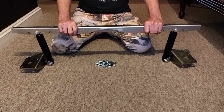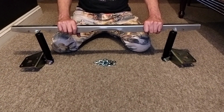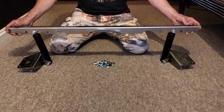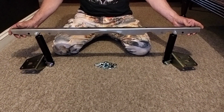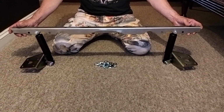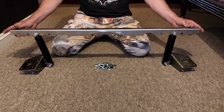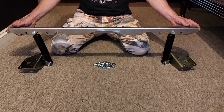So here's the bar, which bolts under the underside of your floor in your boot, just in front of the petrol tank. And the end of these brackets here fit in line with the bump stops on the car, and you may have to trim these bars down because they can be slightly longer than what you need. And then if you really want to, and it's a better job, weld these two pieces to the box sections at the rear of your car.